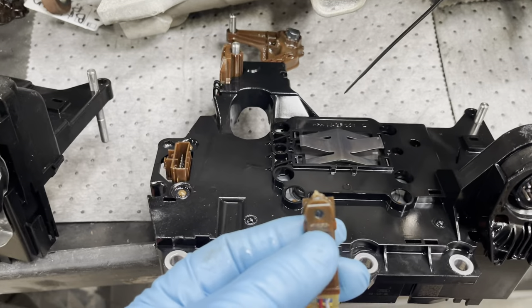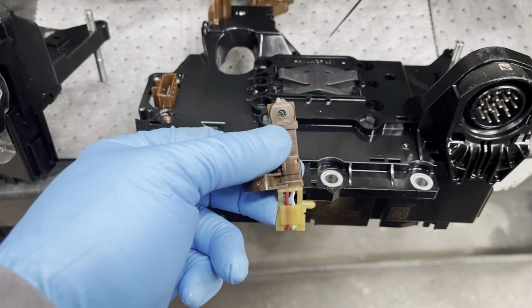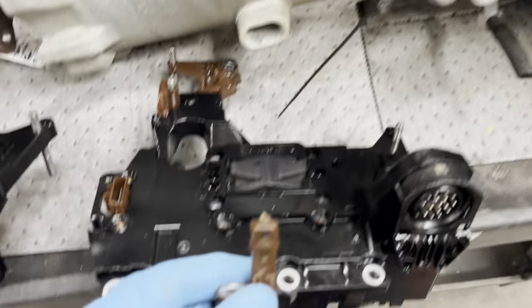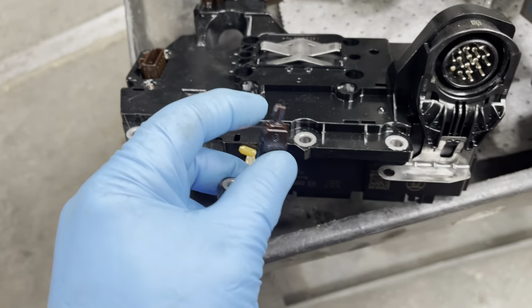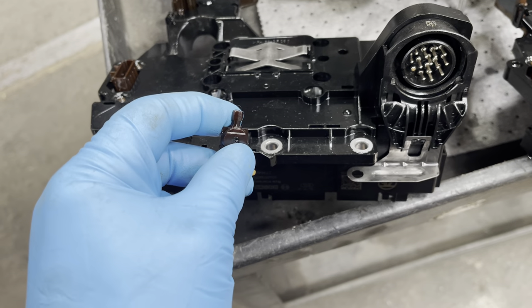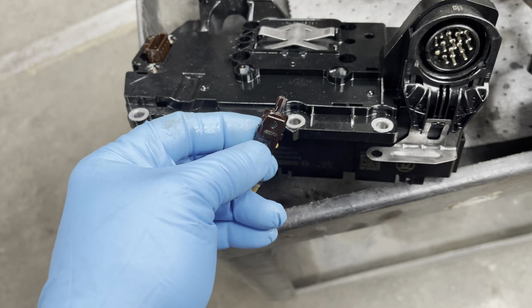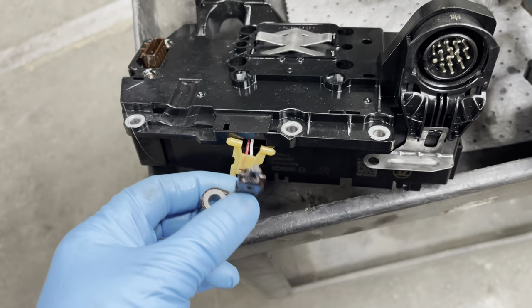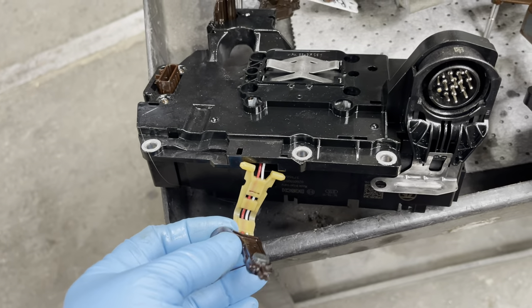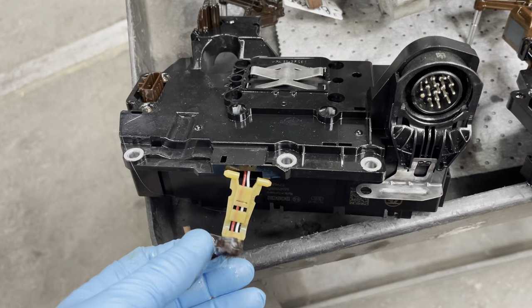This one has been the problem. This is the speed sensor actually for the rear of the transmission. This piece is a guide. As you can see in that one, the guide's gone. It didn't get installed right because it's magnetic — I think it goes in crooked. And then you bolt it down and break the guide, and then the sensor doesn't work. So that's been an ongoing issue: you've got to be super careful about reinstalling the valve body computer.